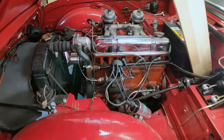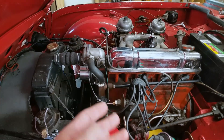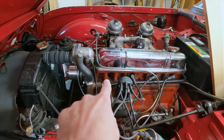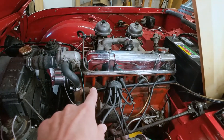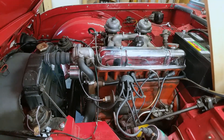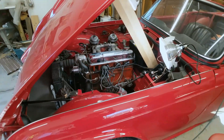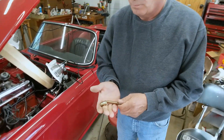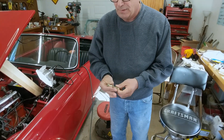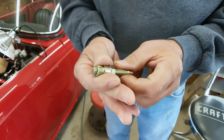What you need to do is get the number one cylinder spark plug removed, because that's the one that when we talk about top dead center, that's the one we're trying to get lined up at top dead center with our mark. So you take that out and then we need to put in a piston stop, which Dad's got right here. It allows you to adjust the length so it'll work on a bunch of different cars.